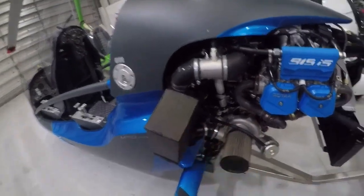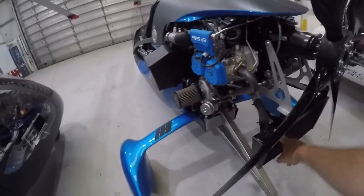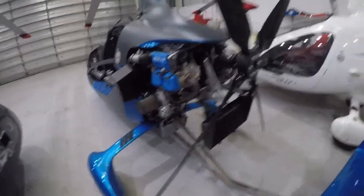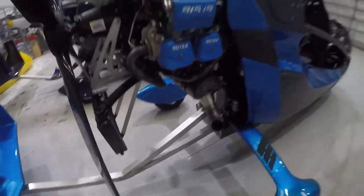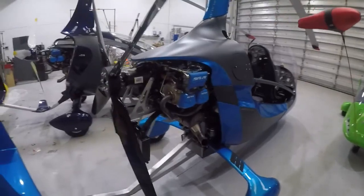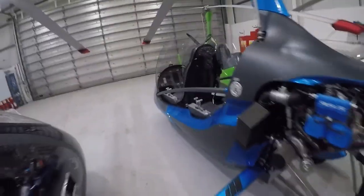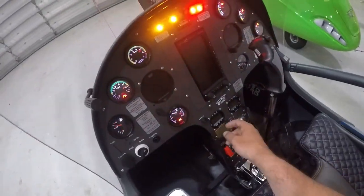How does it translate to flying in the cruise? If you cruise at 80 miles an hour we saw engine RPMs of around 4300 and a fuel burn of 15 litres an hour. If you increase to 100 miles an hour then we saw engine RPMs of 5200 and 22 litres an hour. Don't forget we're with a fixed pitch prop, so those numbers will probably be improved upon with an adjustable prop. VNE remains the same at 120, so typically we are looking at acceleration, take-off performance, and climb performance as being the main attractions of 915 power.